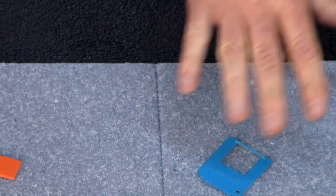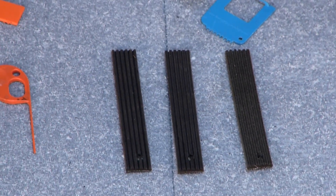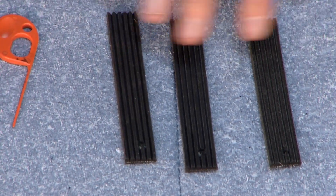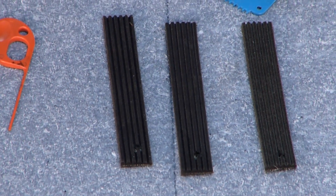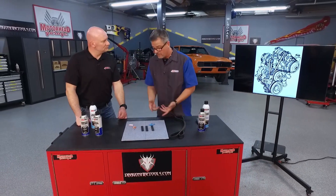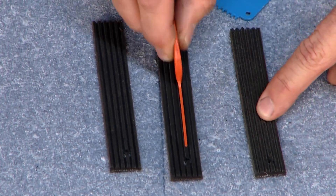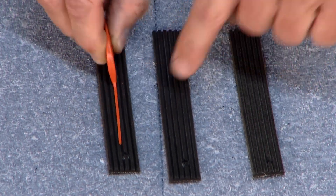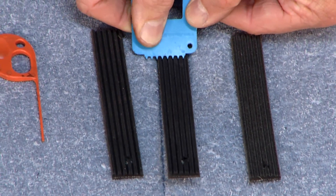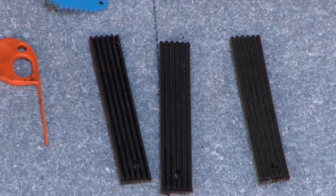Yeah, that's what we did — we just bent it and looked like that. Now new vehicles use new technology: EPDM material, a little bit different than neoprene. You really can't tell by looking at it. So there's a new way to check them — you can get one of these little dial gauges. This one you put in and you feel it, it's poking up. This one, it's starting to get sloppy, and this one it's all the way down in the bottom of the grooves and you can move it left or right. That belt's worn out — a lot different technology.